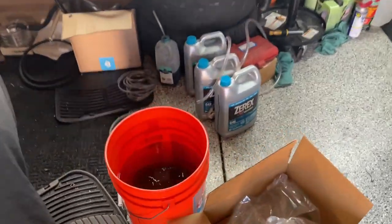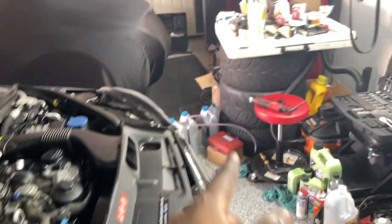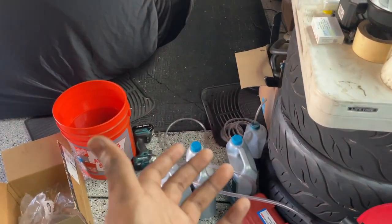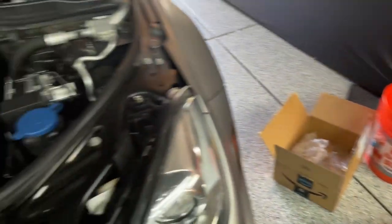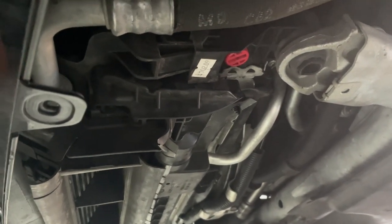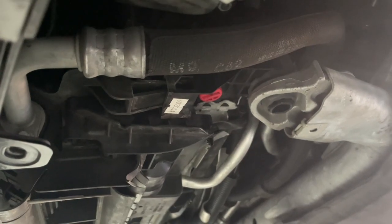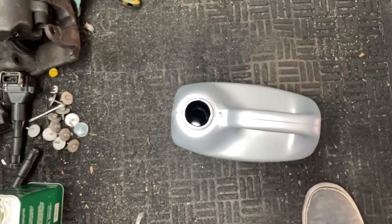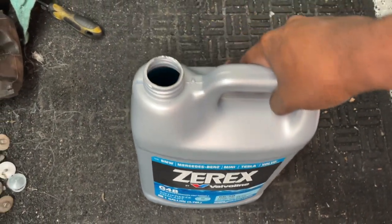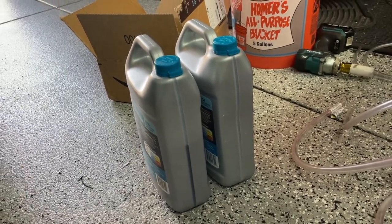This whole bucket is mainly just old coolant with no distilled water mixed in. Now we go ahead and start filling up with the new stuff and bleed the system. I'm expecting to use just over one gallon, maybe one and a half gallons of Zerex. After running the distilled water through the cooling system several times, tighten up your drain plug fully and remove the tube from the access port. Start filling the radiator with new coolant. The Zerex is quite a blue color — it's the 325.0 spec that all M156s have used from the factory, except mine as a late M156 which used 325.5. It came out to just under one and a half gallons of coolant.